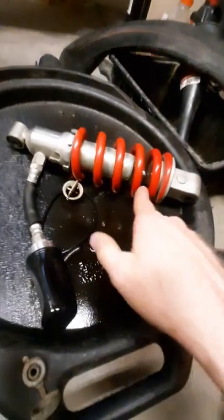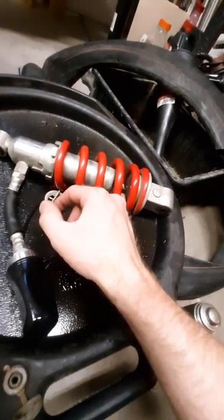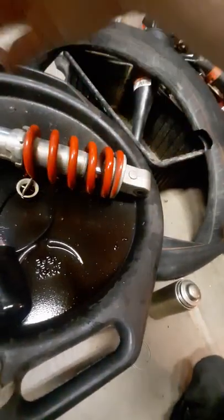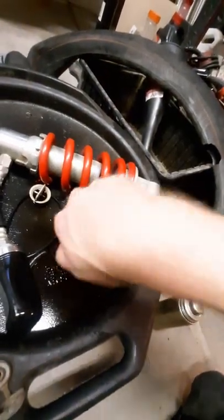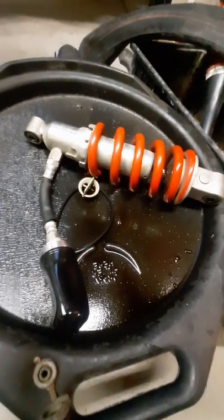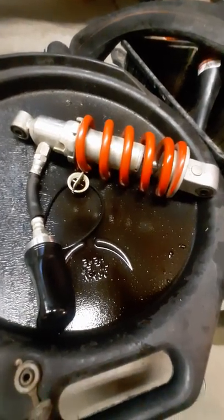That's a full rebuild and I'm not there yet. The bike is working well, and judging by the color and fluid that came out, the one on the bike with even fewer miles is even better. Considering this one has a deteriorated bumper - if that's all you need - you have to strip this thing down completely to replace it. The piston, valving stack, seal head - everything has to come off the shaft before you can slide a new rubber bumper down. It's such a simple part but yeah, you have to go absolutely bare bones for that.